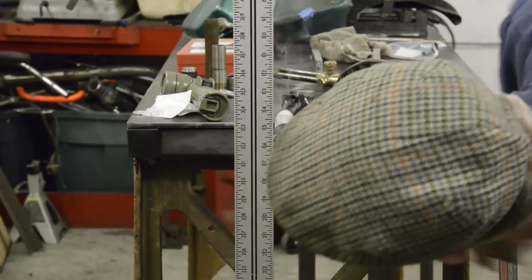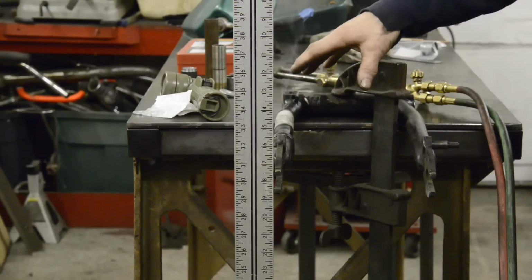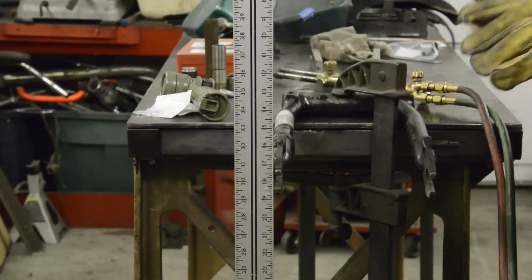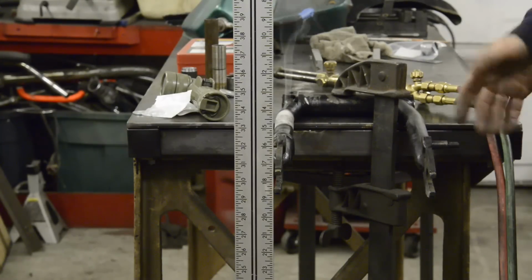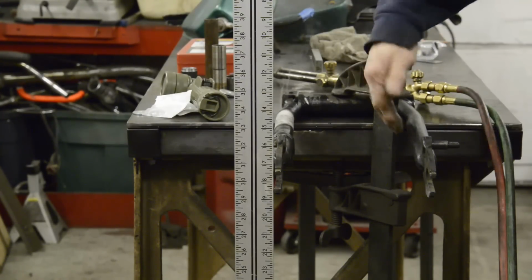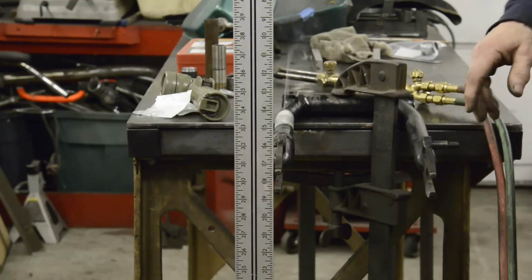Everything's still looking nice and straight there. You know, you could have done this as a press, as I said, it would need a bigger press than mine, and also, as usual, I'm trying to do these things the way you could do it at home. So consequently, nice big clamp, bit of heat, there you go. So anyway, that's straight, we'll let it cool down.